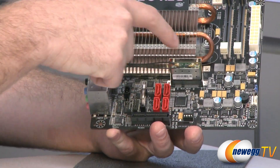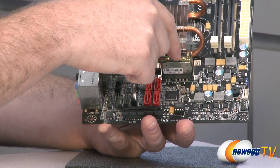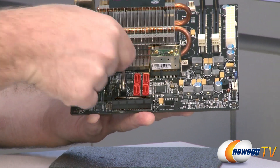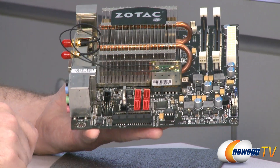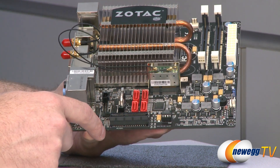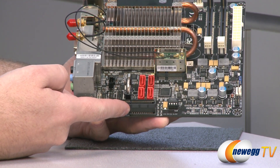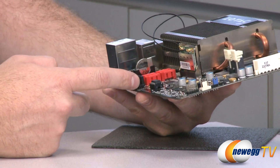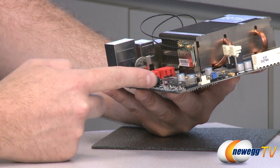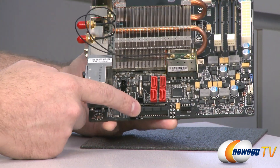Here you can see a mini PCI express slot, and that is currently housing your 802.11n Wi-Fi card. These little cables here go back to connect to your Wi-Fi antenna. These four red ports here are all serial ATA revision 3, 6 gigabit per second ports. This slot down here at the bottom is a PCI express slot. It is wired for four-speed, but if you look at it from this end, you'll notice it's open-ended, so it does give you a little bit more expansion options. You can use, for instance, a full-length 16-speed PCI express card there — just bear in mind it will be limited to four-speed.